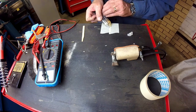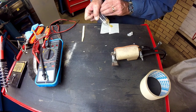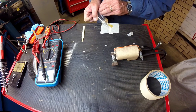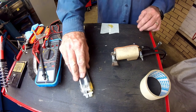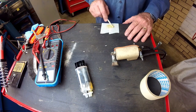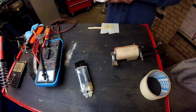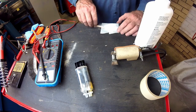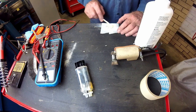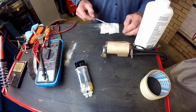I'm resealing the terminal in a fast-curing epoxy resin. After mixing the epoxy I'm adding talcum powder to give it sufficient body to be molded into the shape of the original casing. It's not critical to cover the terminal — not all coils have them covered — but I'm holding to the original design here.